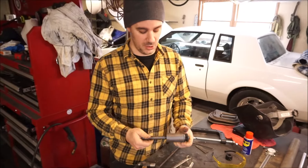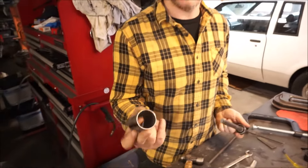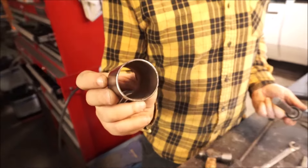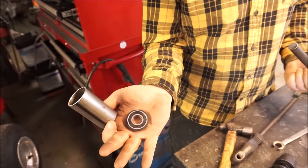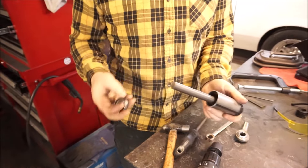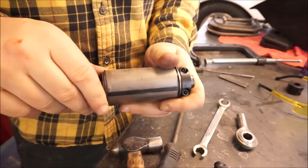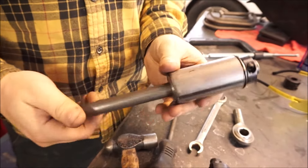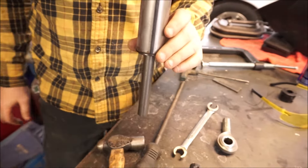Our goal is to have the shaft collar sitting flush with the top of the motor plate. We got our piece of tubing cut to length — it's inch and a half outside diameter, one and three-eighths inside diameter, and that fits perfect with standard bearings for a five-eighths bore. We got the flange style so they don't go in too far. We're going to mount this tube on there as our pivot point and go ahead and weld it in place. This shaft is just for mock-up.